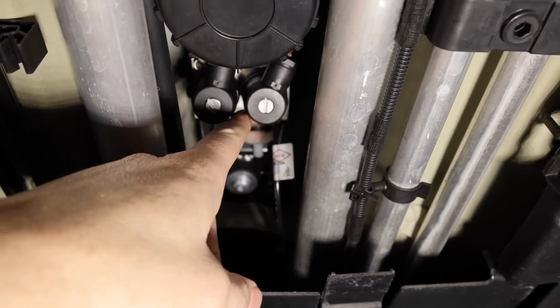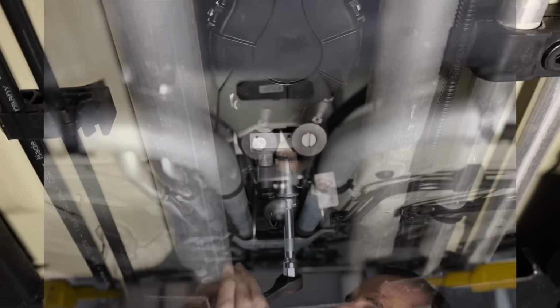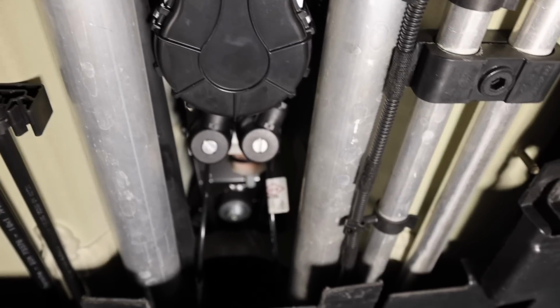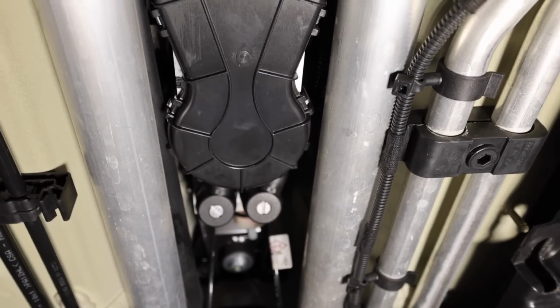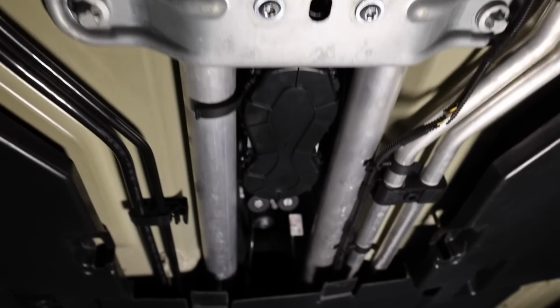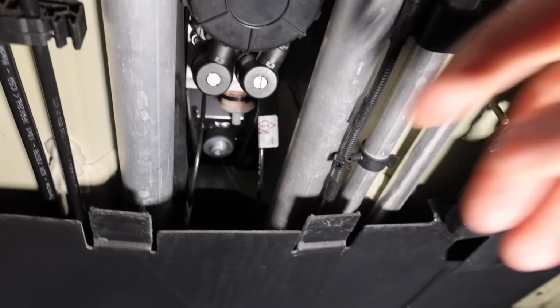So you take this cover off of this side. You do need to really wiggle and sort of get, I believe it's a 20mm socket, but you take this off and replace this piece. That pressure switch tends to fail, and so now my axle lift is functioning again. It's in the transmission tunnel area. So if you're going to change the transmission fluid, it'd be a good time to replace your $400 pressure switch, the one on the left when you're looking toward the front of the car.